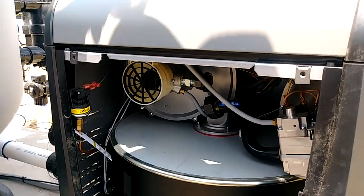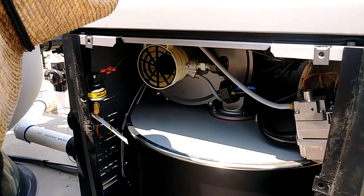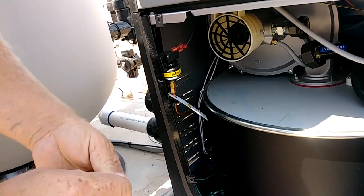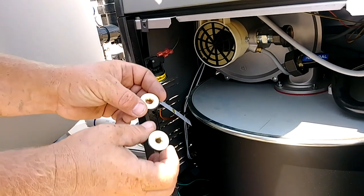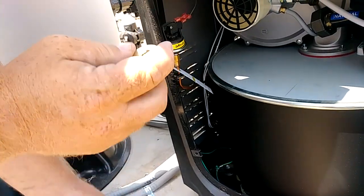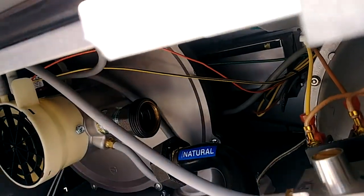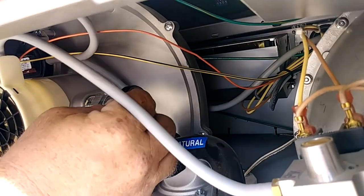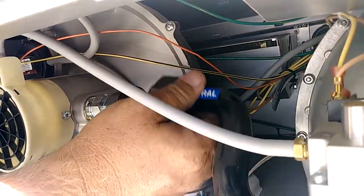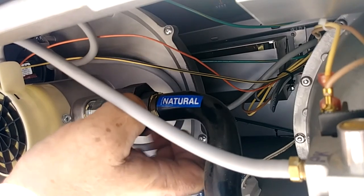Get out the new washer. It comes with a little o-ring that goes on it, so put that o-ring on first. The difference between propane and natural gas is that the propane washer has a smaller hole, because propane is at a higher pressure than natural gas so it restricts the flow a little bit. Slide it in — it's the same on both sides so direction doesn't matter — and push it into that union until it snaps in.